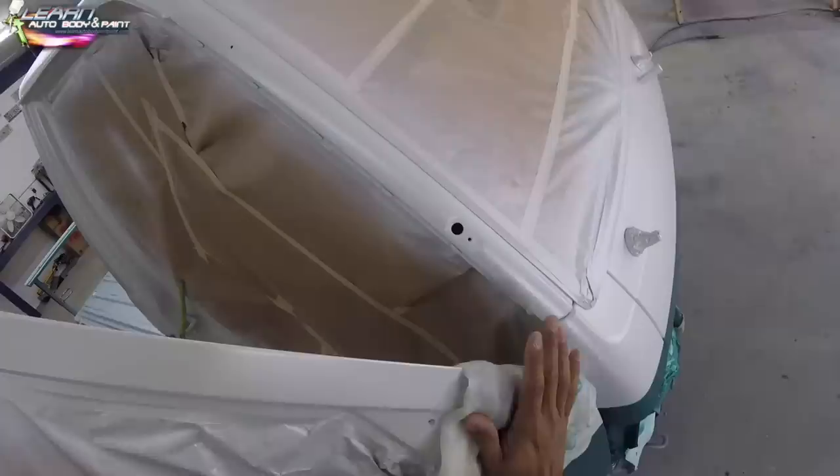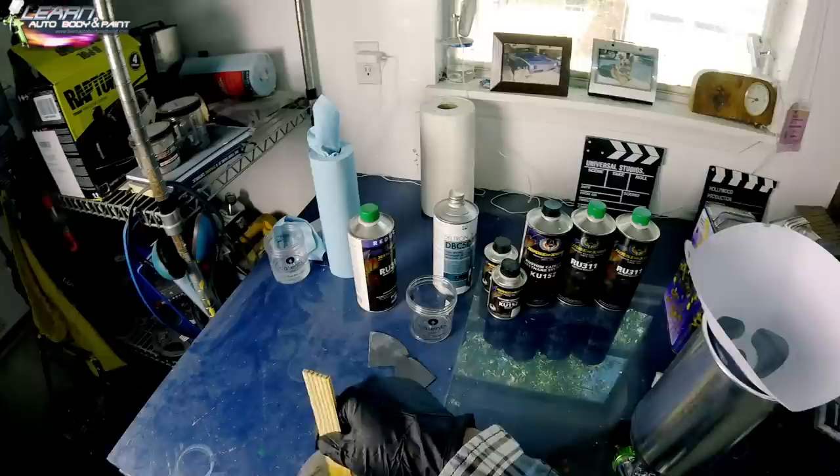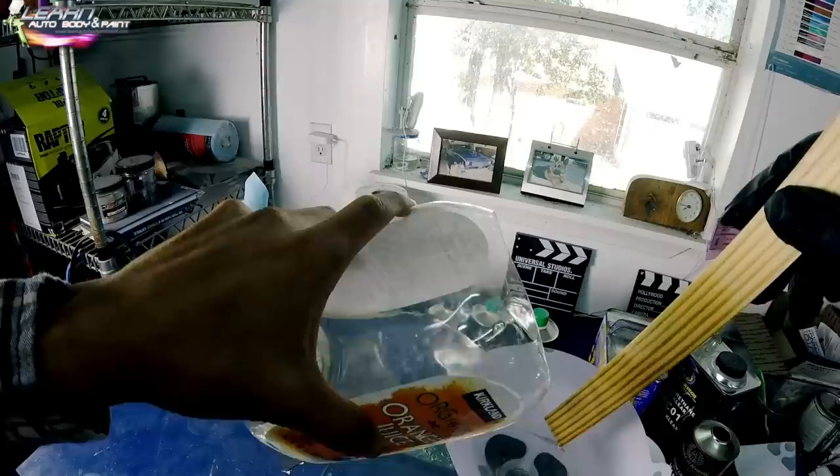What I could do is try to hide the overspray with a pinstripe — I could put a black pinstripe in between here and just black it out, because black does look cool. I might be adding some black pinstripe to this. When you use a tack rag, make sure to open it up all the way, then fold it into a palm-size square and tack everything down right before you shoot. Be sure not to push too hard with a tack rag or you'll get the glue on the paint panels — just go over it lightly.